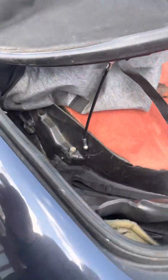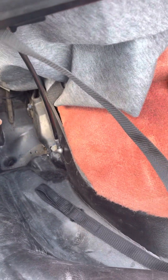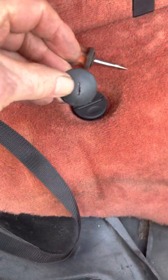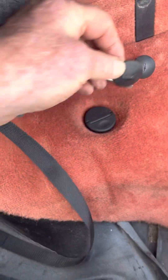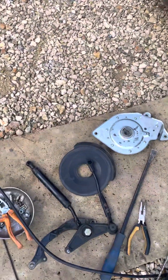To get at the actual transmission - and this transmission on this side seems to be the one that's gone - you've got to lift this plastic waterproofing. It's like a sponge; don't tear it whatever you do. There are a few little plastic stoppers which can easily come out, then you can ease it away. The cable runs along here under it and behind the transmission case.